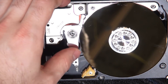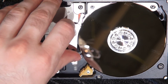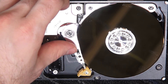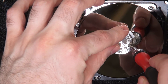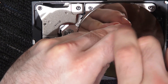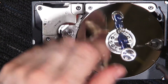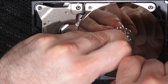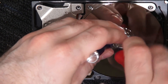Take out this pin here — that pops over and now you can do a platter swap. If you were doing a platter swap, you would not take out any of those screws; you would simply remove that one bumper and it would pop over. You could then attempt to remove the platter. It would be interesting at some point to acquire some old working drives to do a platter swap video, but I do need them to actually be working, so I'll probably have to use cheaper server gear rather than consumer stuff.